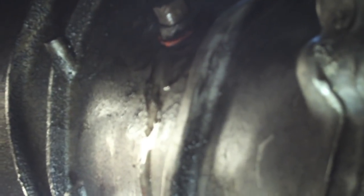And that seeping that comes out of the fill hole will tell you that you're full. Okay, don't forget to clean the fill plug and put the anti-seize on the threads. Hand tighten that fill plug in before you put any tools on it. Okay, and remember to tighten that fill plug to the recommended torque specification.